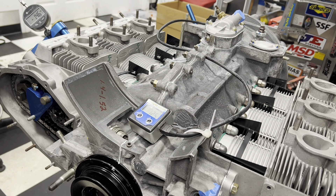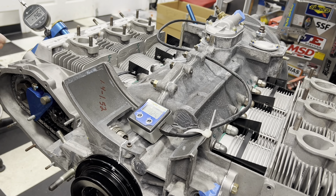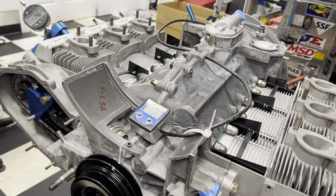We're going to pull the crank back, or we're going to move the cam forward. 12.6 degrees — it might only be one hole off on the sprocket, might be two, but we'll check that out. Roughed in, we're 12 degrees off. The motor would run, it just wouldn't have all the pep it's supposed to. That 146 number is what we're targeting. We're going to move the sprocket by one hole and see if that gets us where we need to go.